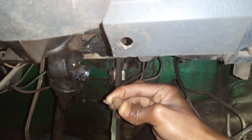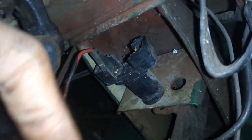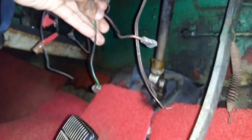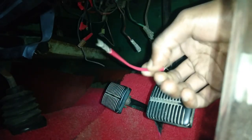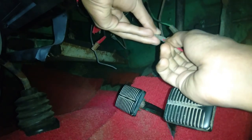Before checking the switch, for sufficient space it is detaching the brake pedal spring from the dashboard. Okay, it is detached. For checking the switch, disconnecting the first line — okay, it is disconnected. Disconnecting the second line — it is also disconnected. Take a piece of wire, remove its insulation at both ends, then insert this piece of wire to the points of these disconnected wires like this.